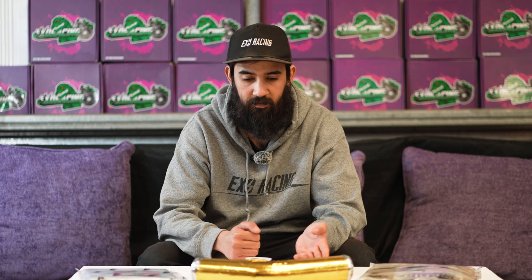We actually have an all-wheel drive Civic build — we turbocharged it about five or six years ago and were always struggling with temperatures. We tried wrapping the intake pipe and running exhaust wrap, testing different configurations over the years. The best temperature we achieved on the dyno was when we had reflective tape on the intake — the intake temps were just over ambient and heat soak was minimal. We haven't done a full back-to-back test yet, but we're going to do that with a thermal imaging camera to show exact temperature drops, using the Haltech setup to data log as many sensors as possible.